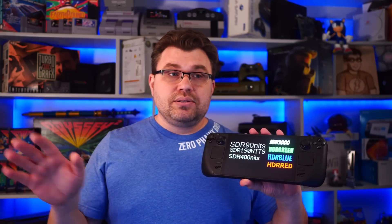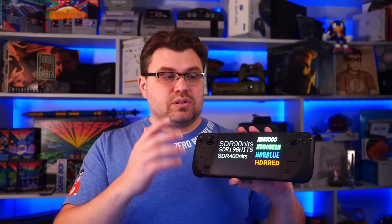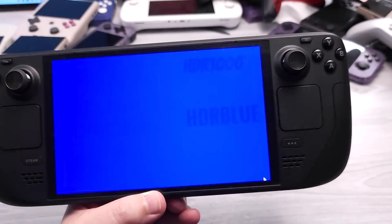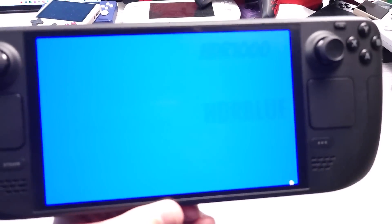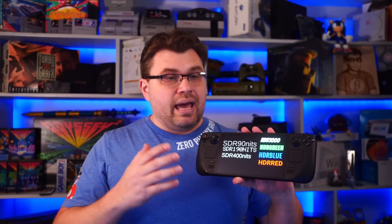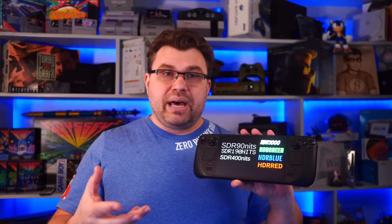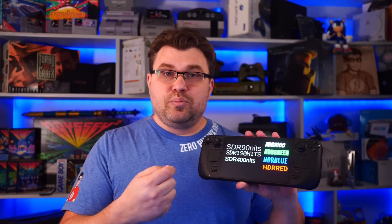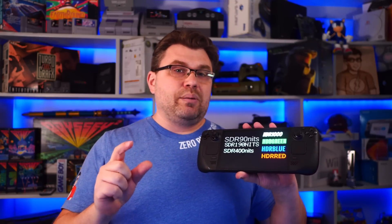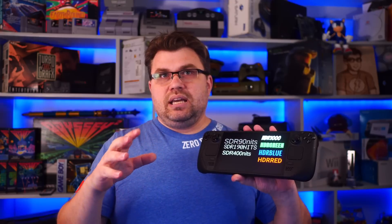When we look at just flat colors, we can't actually see any image retention on the SDR side at all. We can only see it as basically the inverse of color. So if we use a blue color, green and red don't show up, but blue shows up because there's less emissiveness from those sub-pixels. You can see a clean outline, likewise for green and red. On white or gray, because blue, green, and red have lost their emissive impact on those sub-pixels, we see a tinge of color — on the gray side it looks almost yellowish because there's more red and green.